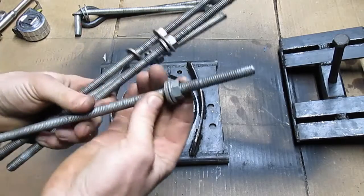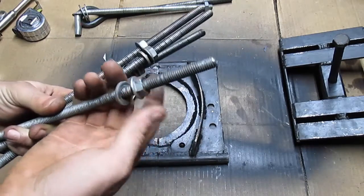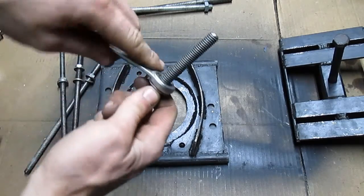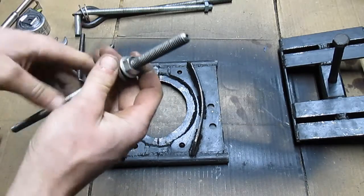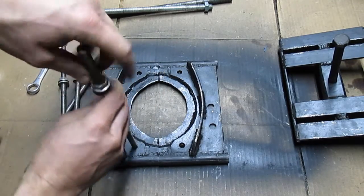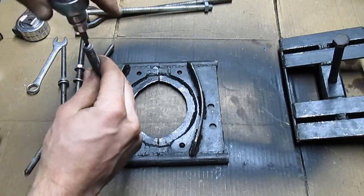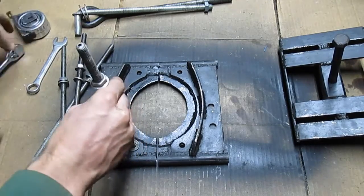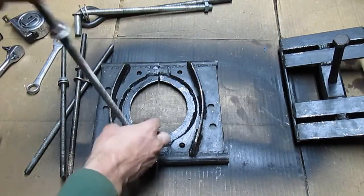You can see that these nuts — true to the theme — were lock nuts. I didn't have any flanged 7/16ths nuts. I wanted a flange so when I put the wrench on it doesn't fall away down. So I just ground the lock nut bit off of it. Another thing we did to make it easier to install these studs: we put a Torx into the top of them. You guys saw that in the video putting it on. We installed the Torx so we can easily take them in and out, which makes it easier for assembling and disassembling the puller on the shaft.